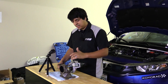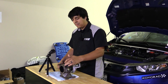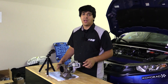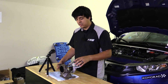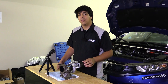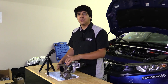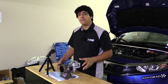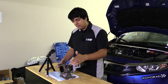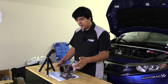Now the other part is going to be this housing - this aluminum piece up here - that's going to be the compressor housing. Back here we have the turbine housing. Honda used a lot of different materials in this turbocharger unit. It is built by Mitsubishi Heavy Industries; it's a TD-03 style turbo. They use somewhat of a stainless steel housing here that will help control heat from being expelled out into the engine bay. Same thing with a lot of the other components, such as the arm here for the wastegate.